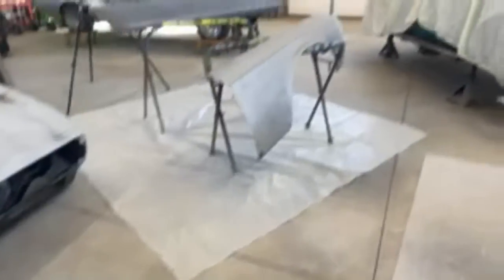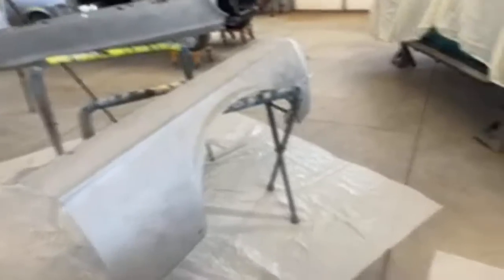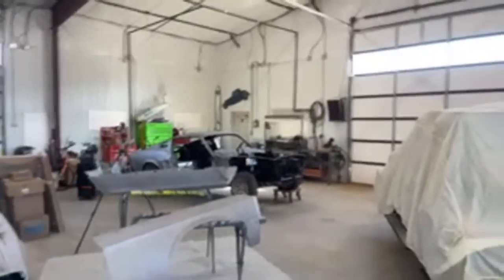We were talking about epoxy primer, sealers — and I've got a lot going on here. Besides all this prepping, I've got to do everything in that box and this piece right here. So remember: if you are sandblasting or dustless blasting, remember that the metal is not ready. It is not ready for any type of paint, primers, or anything — you have to prep it. You saw me do this door — this door is smooth as glass, very nice. It is prepped to put our epoxy primer on so we can continue to work on that car.